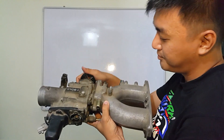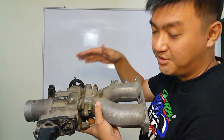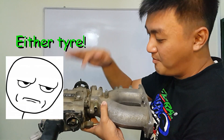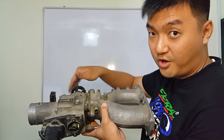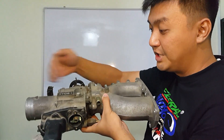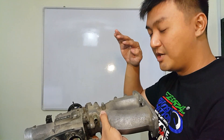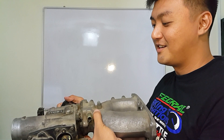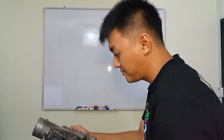What this does is: when you accelerate too much and the ECU detects wheel slipping on either tire, it will reduce engine torque by reducing your throttle body position. It moves the butterfly valve to reduce air coming in, so you'll feel your engine revving lower and you'll have less wheel spin. In drift or in racing we don't want full traction control because we want to be fast.